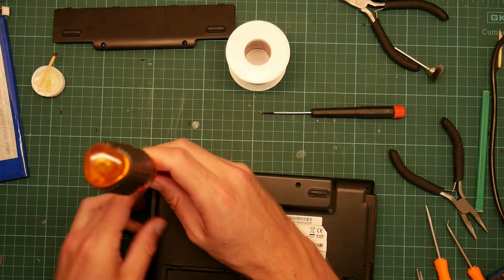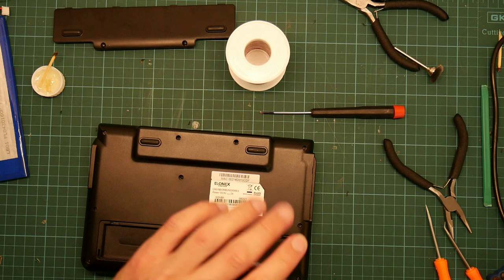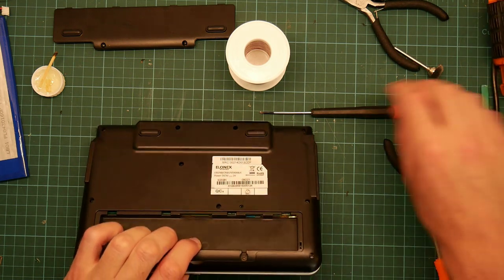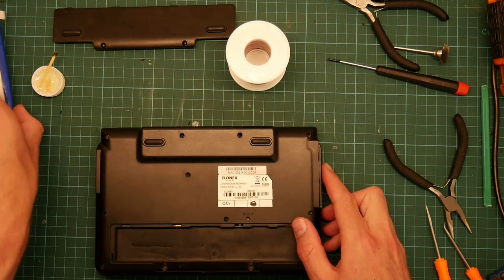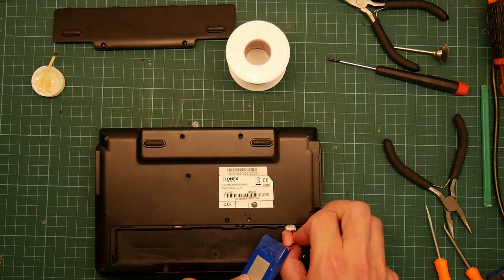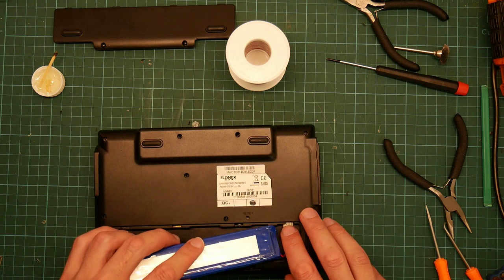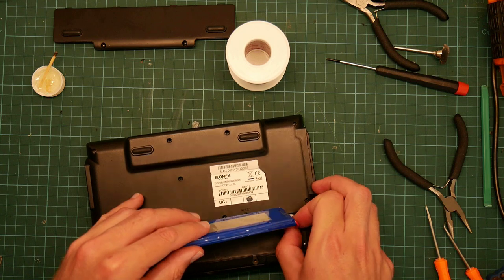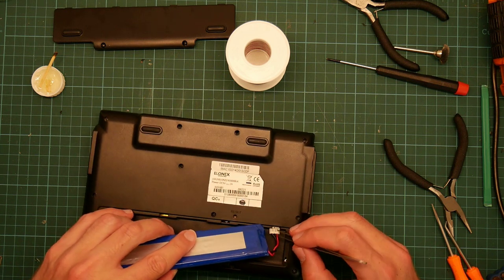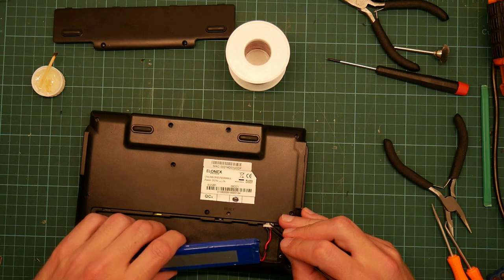It's not turning. The way you break the file manager protection is you put an EXT3 formatted SD card in the slot, which it will mount fine. On this there is a symlink from a text file to the file in /etc that's got the list of directories that you're allowed to access with the file manager. Because this is a user file, it'll let you access it and edit the text file, which of course edits the file on the main file system, which is kind of, that's not how security works. So you can simply tell the file manager that the user is allowed to access all directories. And then that just means the user can access all directories.